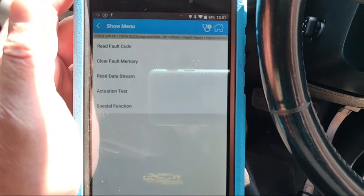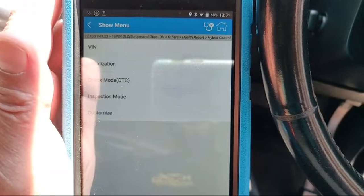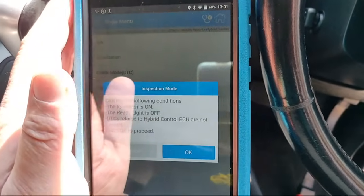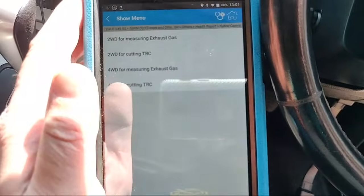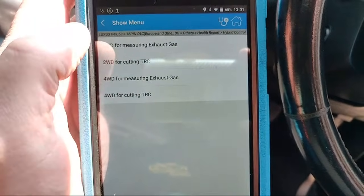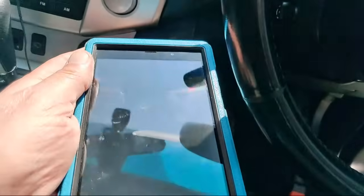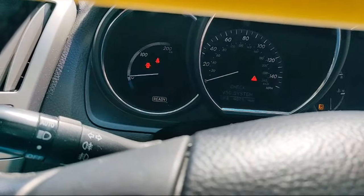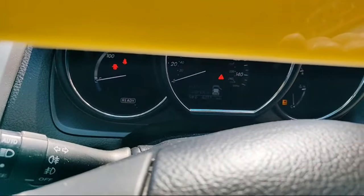If you remember I did a video the other day on putting the vehicle into inspection mode - we can actually do it from the scan tool. Going to special function, inspection mode. Ignition switch is on, the ready light is off - that's fine. Selecting the type of inspection mode: let's go with measuring exhaust gas. Please turn ready to on - so I just turn my key to ready mode so the ready light comes on, and there we go - my engine starts and it won't cut out now until I cancel the function or turn the key off.